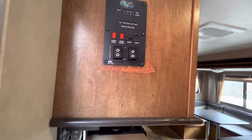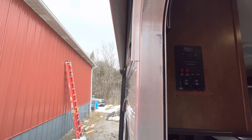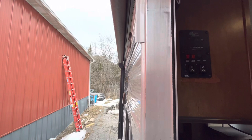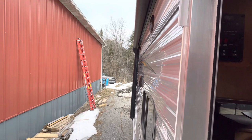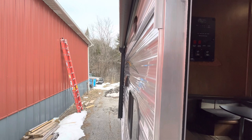Because it is an electric awning, you have to watch it while rolling it out — it doesn't stop on its own. When you're rolling it out there'll be a valance that folds down at the end of the tube; once you see that fold down, let off the switch and it's all the way out. If it's really windy or starts down-pouring, you'll want to roll it in so no damage is caused. On each arm you can adjust the pitch of the awning so water runs off. But if it starts down-pouring or is super windy, either don't roll it out or make sure it's rolled in — and definitely roll it up before you go in for the night.